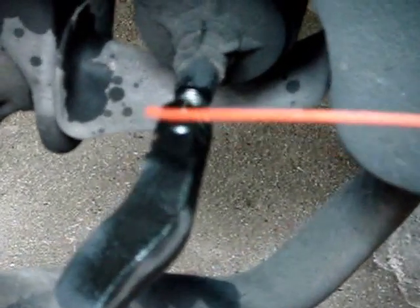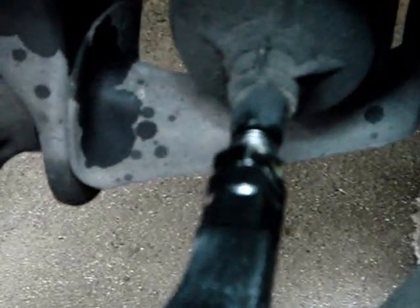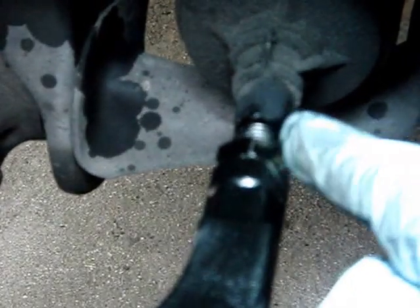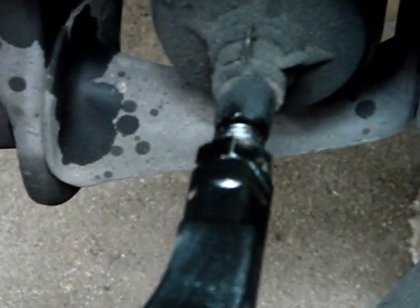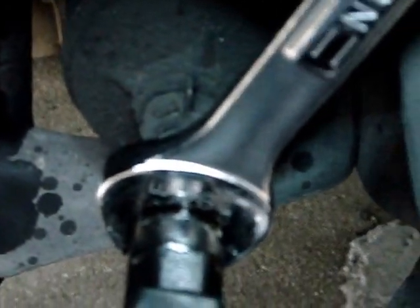The next step: I put a little bit of PB Blaster on this nut and also on the crown nut. I'll let it sit for maybe 3 or 4 minutes, just enough so it can saturate. Then what we're going to do to get the tie rod off — there's a little nut here we're going to loosen up and push inwards. The way we do that is with the 19mm wrench. Basically, I'm putting this 19mm wrench on this nut and using force to loosen it from the outer tie rod.